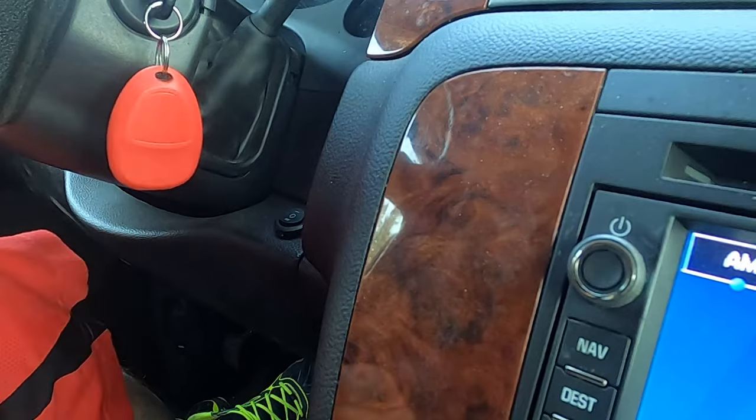Alright, so we're in relearn mode. Now that we're in relearn mode the procedure will be the same with the tool. Without the tool you start at the front left tire, wait until the horn beeps, then go to the front right, the back right, and then the back left — just go around the vehicle. The corner lights will light up on the vehicle.